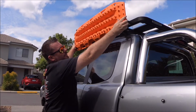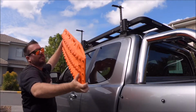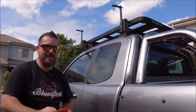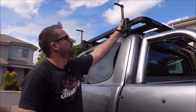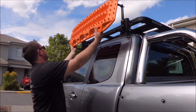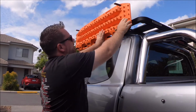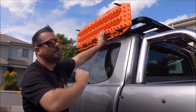So perfect example, guys. That's not the right dimensions. So I've obviously cut once and measured once. And so what we do by keeping them loose, folks, is we can actually wiggle our mount to where we need it to be. So let's try there. Beautiful. There we go. So what I'll do is I know that's the right position now, guys, and jump up, tighten it up.